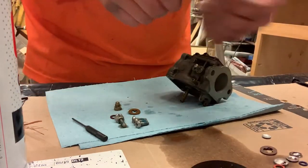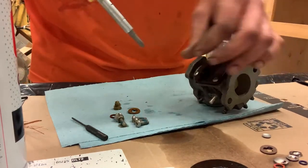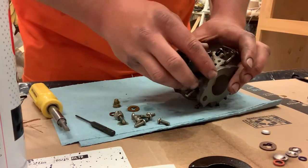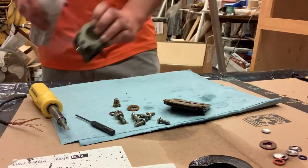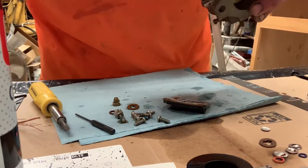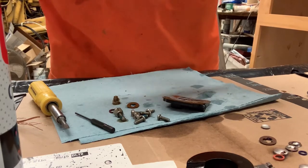Now back to the Phillips — we're going to take this top cover off, it's just four Phillips head screws. This one can be a little tricky to get off. Once it's off, same deal — squirt it down and take the little brass brush. Make sure you use brass and do not use steel, because steel will scar the aluminum pretty bad. Brass is a pretty soft metal so it doesn't tear it up as bad — I made that mistake one time.